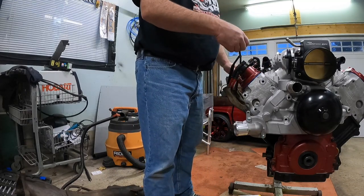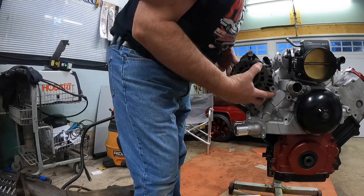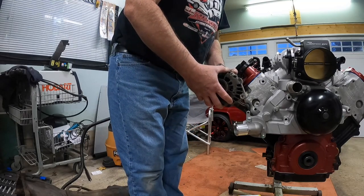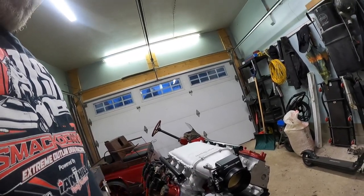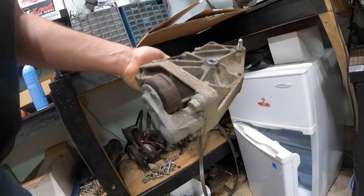I'm hoping to have the dipstick right about here, because the alternator is going to be there too — maybe there, maybe somewhere around there. I'm going to put the alternator somewhere here. I might be able to use that hole in the block as part of my alternator bracket. Actually, I can use that hole to make a bracket to mount the top of the alternator. We got this figured out — this is going to be mint. We've got lots to work with, we're going to do some serious fabricating around here. There's a tensioner I might be able to use too.